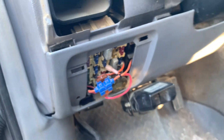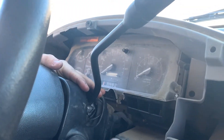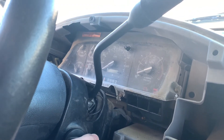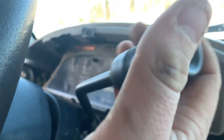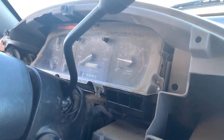You'll see once we put it in the truck — once it's in, it's fine. It doesn't pop right away. I'm going to put my ignition back in real quick, turn the key, and then try to put it in park and see if it pops again. So what we did is we put the plastic top back on and put our key in the ignition. We're going to start the truck up — good old cold start. And now I'm just going to put it in park. You can see our tachometer is working. Everything is working. Look at that — no way. They all work now. So fixing that handle stopped our fuse from consistently popping. That just killed two birds with one stone. That's perfect.